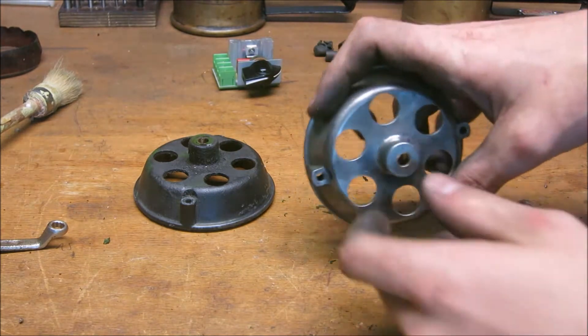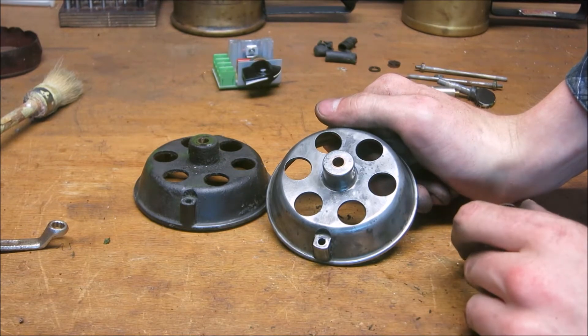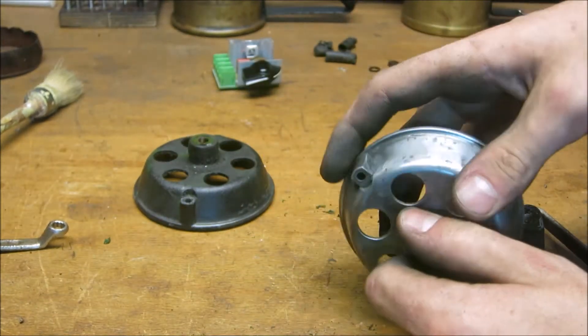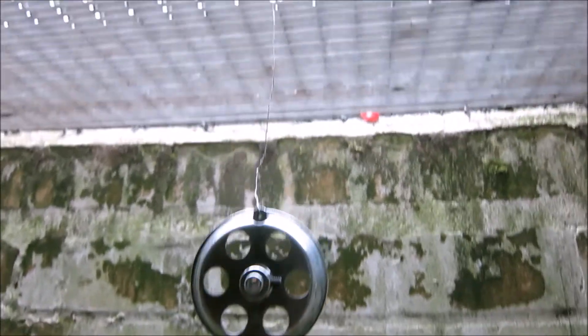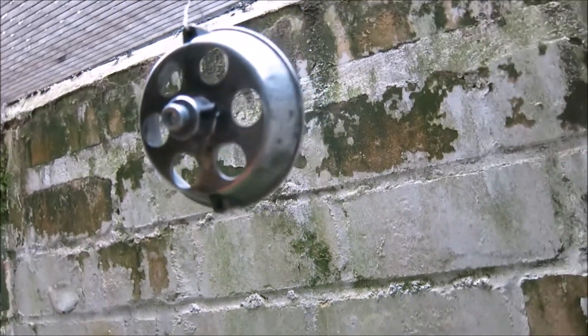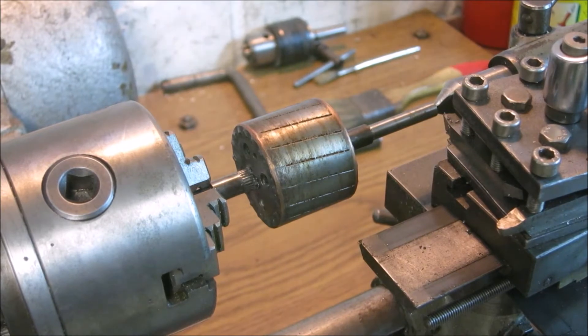The paint is going off pretty quickly. The only things limiting me are the power of my wire brush motor and the fact that this is aluminium, because I don't want to score it. This took me barely 10 minutes, so I'll be through this quite quickly. While I polish the other parts, I'm going to prime this one already so I can coat it after. Here it is prepared for painting — I hung it up by a wire and plugged the bearing openings with two screws so no lacquer can get in there.